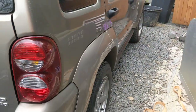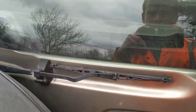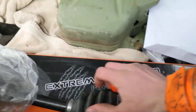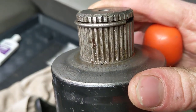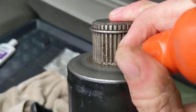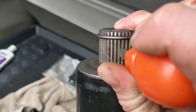This by the way is a diesel Cherokee I picked up for hardly anything — it's only got 70k on it and it's in immaculate condition. So here's the end we want to look at. You can see the condition of new splines — we can get the screwdriver in as a comparison. There's far more depth in there, and if I try and move it side to side there's no movement.